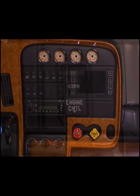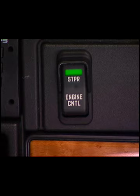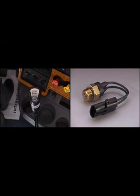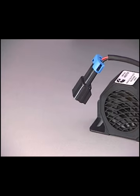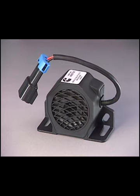The sleeper engine control switch is located in a switch pack in the center dash panel. It is a two-position latching switch that enables and disables the engine control switch in the sleeper compartment. The engine control switch is a two-position momentary switch located in the switch pack of the sleeper control panel. If the vehicle is equipped with a manual transmission, a neutral safety switch is used to verify that the transmission is in neutral; this switch is located on the transmission. The hood switch is located on the driver's side splash guard near the headlight and disables the start-stop function if the hood is open. Whenever the remote start function is used, an engine start alarm warns anyone near the vehicle that the engine is about to start — this alarm sounds for 15 seconds prior to the start of engine cranking and is located in the driver's side engine compartment on the air cleaner mounting bracket.